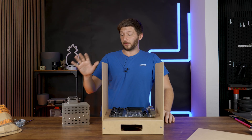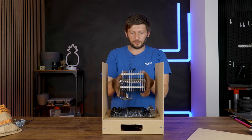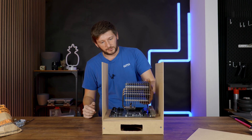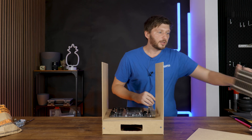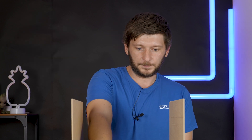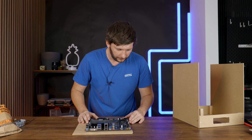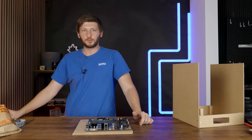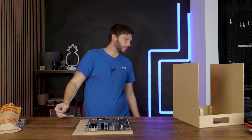So far we have the P1 centered left and right, and centered top and bottom. Now we need to make sure the whole thing is centered front to back as well. I'll need to mount the motherboard as much to my side as possible otherwise it'll never be close to centered, but that's not an issue — I can just push it down and drill the hole somewhere else. This part will actually be really easy: all I need to do is somewhat center the motherboard, mark my screw holes, drill them, clap these little spacers in there, and the motherboard is done. Then I can glue the plate in and it's finished.